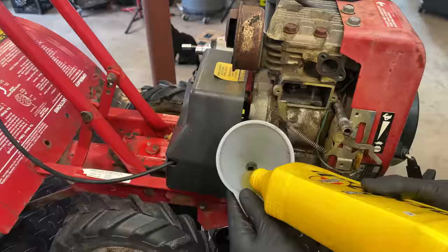The intake, you don't want to have loose, because if that is loose, the intake's exposed to engine vacuum, and that'll pull oil through. It'll cause your engine to smoke. It also pulls through unmetered air, so instead of going through the carburetor, it comes up through the valve guide, and the engine runs lean and runs hot, and the oil also causes a lot of carbon buildup, which will cause issues with the valve seating properly. So although this isn't great, I think it's the best case scenario. It'd be a lot worse if the intake was like that.